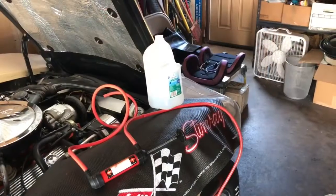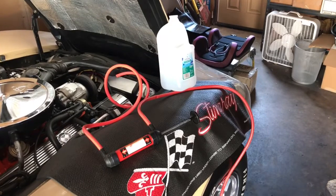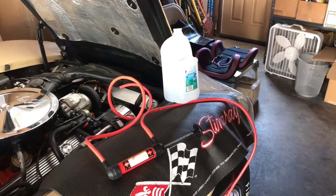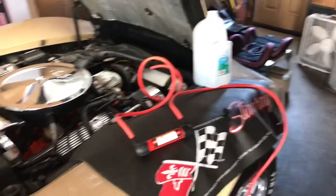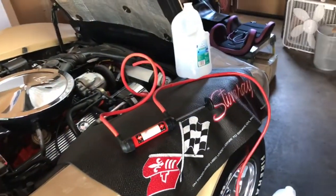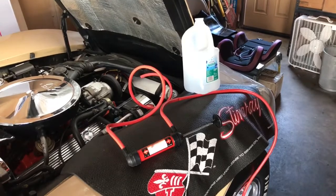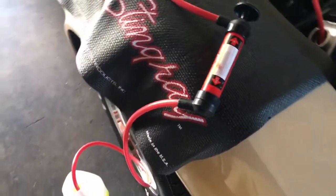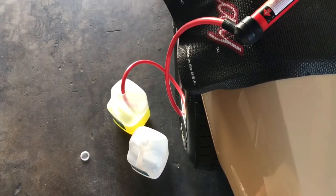The first thing I'm going to do is drain out a significant amount of the radiator coolant. I'm going to try to use this pump and put it into gallon jugs in order to reuse some of the fluid. I want to get the fluid level down below where the heater hoses connect to the heater core up against the firewall, so a lot less fluid will come out when I disconnect the hoses from the heater core feed nipples. It looks like the pump is going to work. The feed line goes down into the radiator, the output line goes down to the gallon jug.